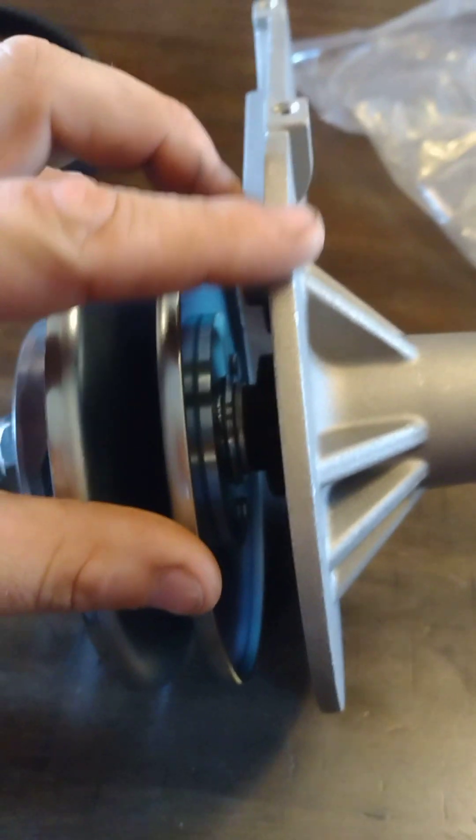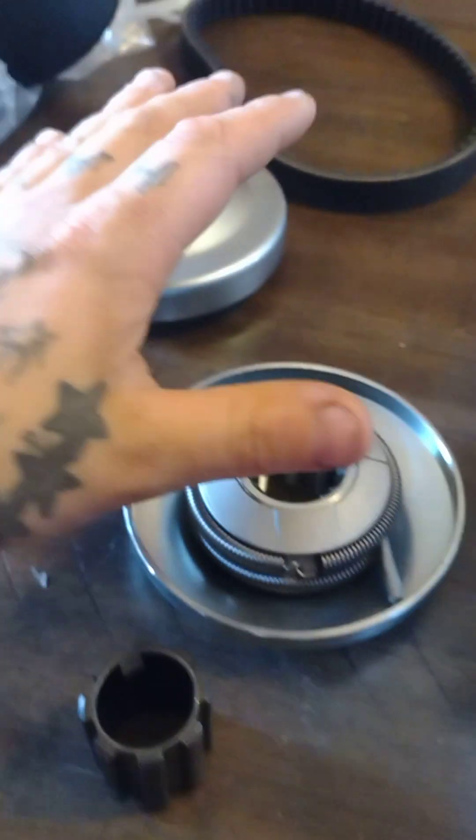You can always make your own jackshaft. If this backing plate was to break or crack, you don't really need it — that's just for the jackshaft setup. You can just mount this on your engine, make your own jackshaft onto the frame somewhere, just make sure it's all aligned. You really don't need this backing plate, so if it broke or cracked, whatever — I don't care.